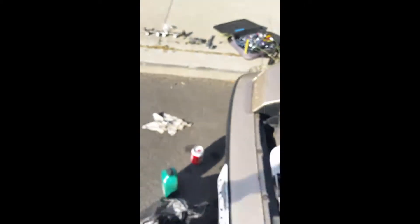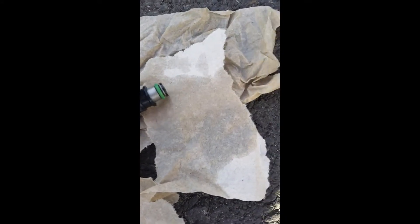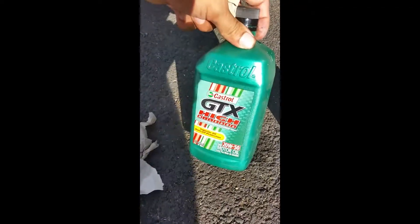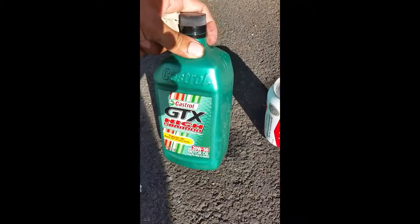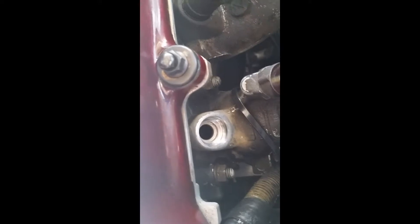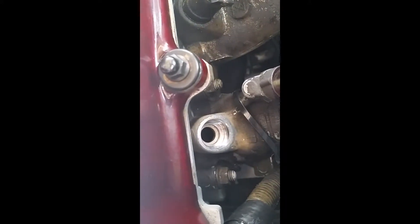I'm going to wipe it down a little bit and clean it up and then put some motor oil on what's going to be the new cushion and ring. I'm using a 20w50 that I had sitting around — just put a little bit on the O-rings and the cushion. I feel like maybe it'll withstand higher temperatures because it's a lot thicker. I also used a little MAF airflow sensor spray to get it really clean — used a non-shedding cloth first, wiped it dry, then applied the MAF cleaner.